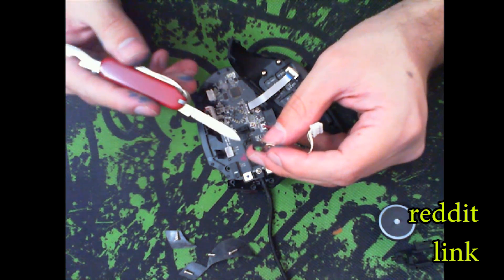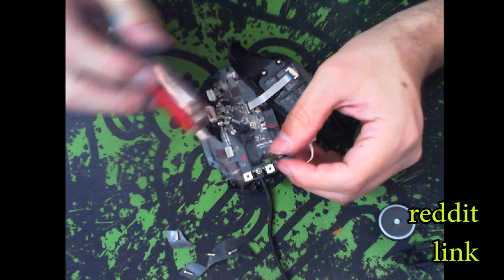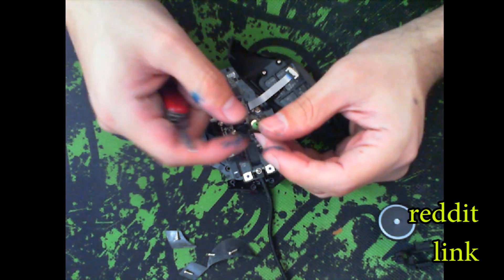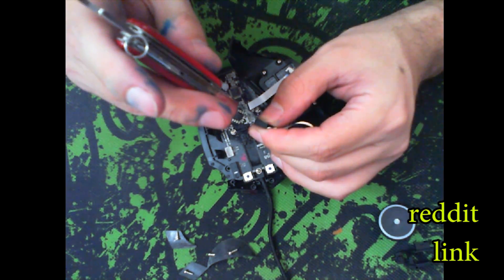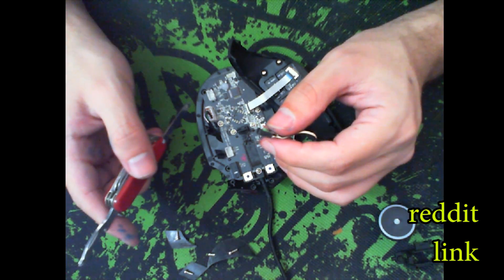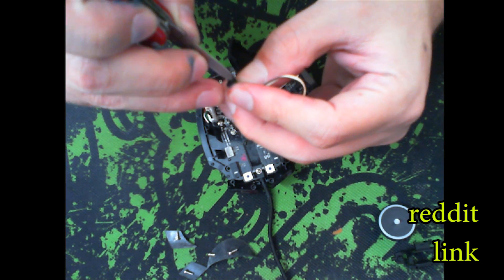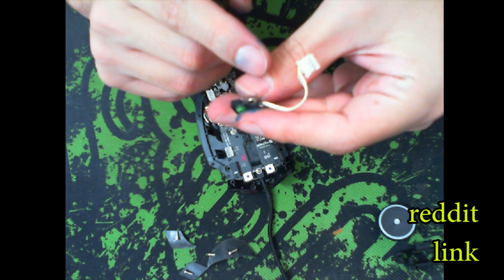So what he did, and what I did: depending on how you disassembled the piece, all you've got to do is grab the metal D between your fingers and bend it a little bit more. We want the metal D to apply a greater amount of pressure onto the wheel so the copper touches perfectly and doesn't create a short. I shift my knife under it and twist it, forcing the metal upwards and increasing the bump that's already there. I'll do the same to the one on the other side while I'm here.